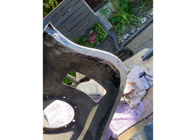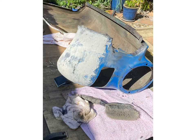This is the better of the two wings, but it still had a lot of rust on it. What we did was plate it up and weld a new lip on it because the lip had rotted away from dirt kicked up by the wheels. We welded that up and reinforced it with some fiberglass and resin so mud and water kicked up by the wheel in the future won't hit bare metal and cause rust.